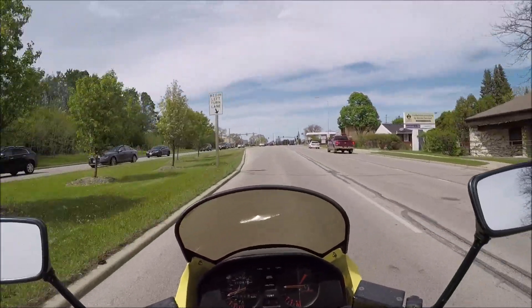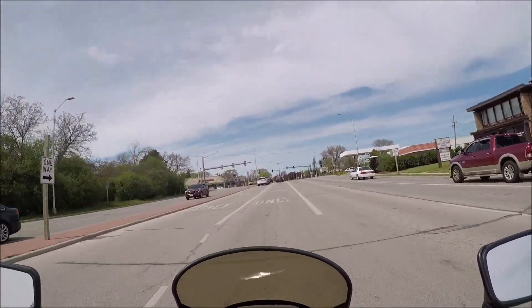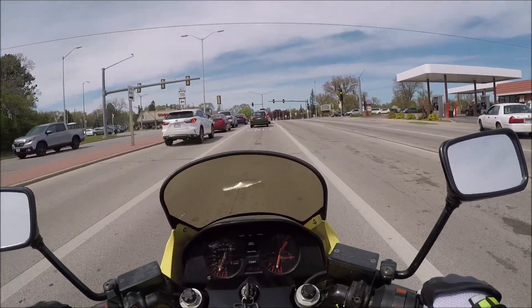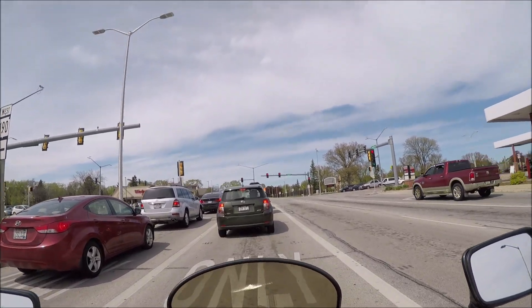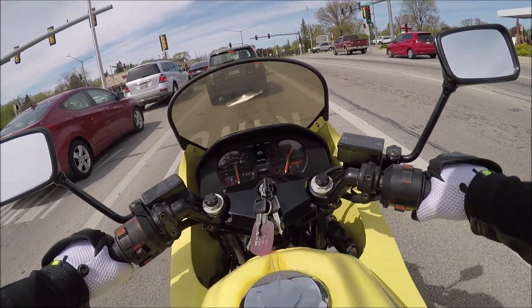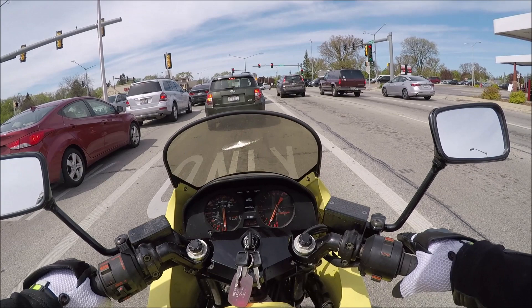Hopefully the wind noise is getting knocked out with the way this Purple Panda microphone and dead cat are set up. It just sounds like I'm dropping too many RPMs when I get off the throttle. I'm glad that it drops the RPMs so quick — that's indicative that I don't have an air leak or something like that. But it seems like I'm dropping a little too much.